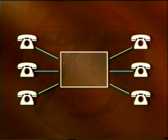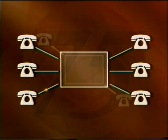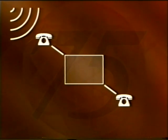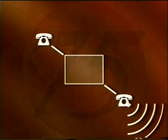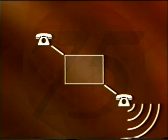The bus systems vary slightly, but it may help to think of them working in a similar way to a telephone conference network, where several people can all speak and hear each other, yet the dialogue is passed backwards and forwards along only one or two wires. A telephone converts speech into electrical signals passed down wires via an exchange to another phone, where the signal is received and converted back into speech. The system is bi-directional, allowing conversations to flow both ways along the same wires.